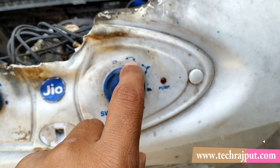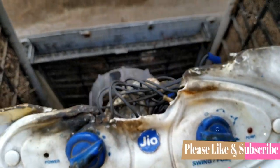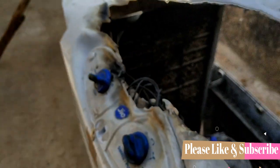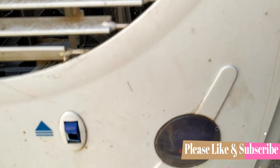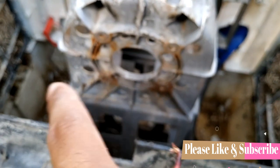This cooler has a swing here, water drop system here, swing motor here, and pump here — that is the whole cooler inside. Overall it is not very special, but it gets the job done. The capacitor is 5 microfarad — if you need to change it, you can, but it is very compact to access. Thank you very much for watching today.